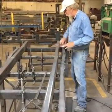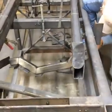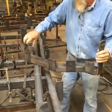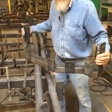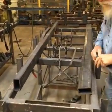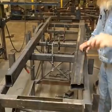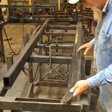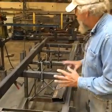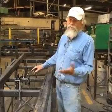The way this frame is, if we cut the frame all the way through, you can see we can bend it to match our jig, and then we'll fill this in. Same back here, we'll fill this. We'll make a piece for the back — we've got a jig for that. This would be the back of the car here. In the front and the back it tapers a little bit. What we'll do is cut it from this line right here, and they all have a frame horn, so we'll put the frame horn on it. It'll have that angle coming down from there to the frame horn. We'll even box the frame horn — it just makes it a lot stronger, a cleaner job. When you put your transmission cross member in there, everything's mounted. So we've got the modern 350 transmission.